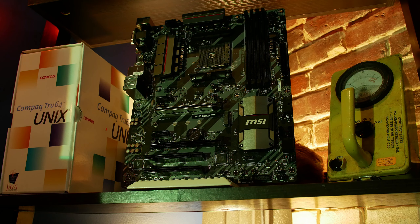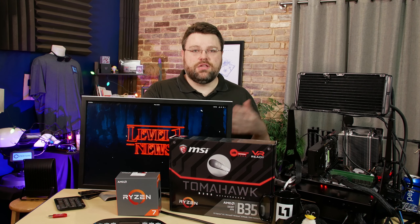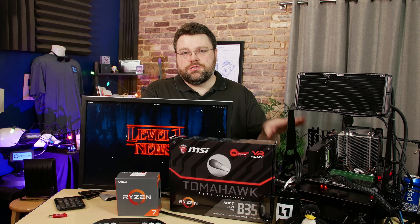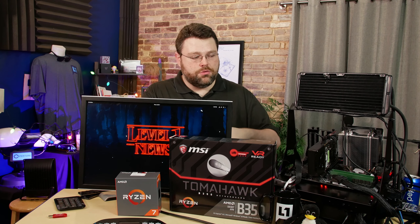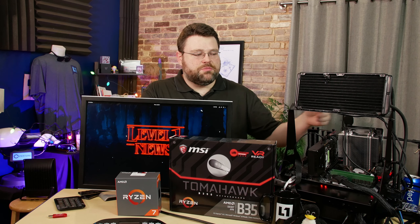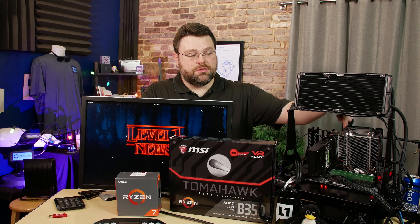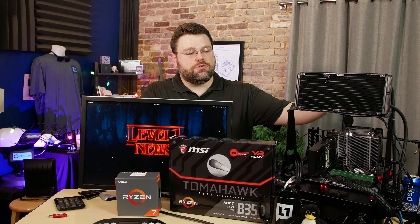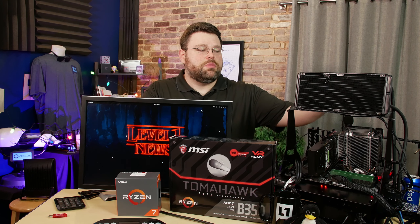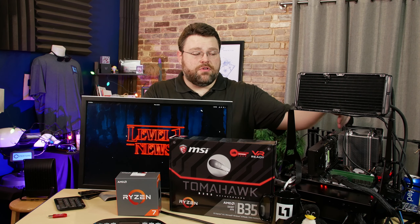Overall the board was pretty solid. I put it through a grueling burn-in test for 48 hours running benchmarks continuously with the 3.9 GHz overclock, using the enclosed test bench with a 140mm cooler blowing over the motherboard — that worked really well. I like the layout of the expansion slots. There's ample room between the CPU and the first x16 slot. There's an x1 slot in there, but if you're using an oversized cooler like a Noctua D15, you've got plenty of room for that and a full-size graphics card, even one with a backplate.